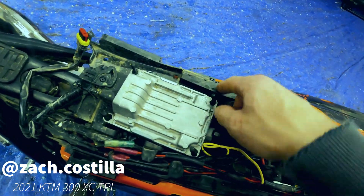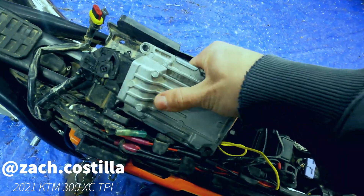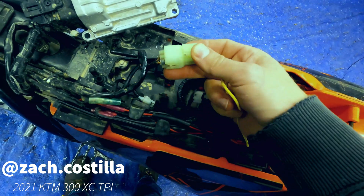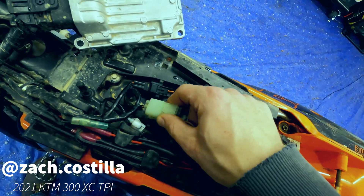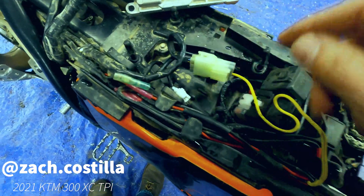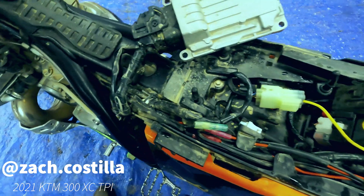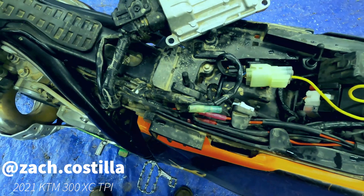And then under the ECU — there's this white plug right here. Where the yellow lead comes out, that's part of the kit. There's just this empty white plug down here on the XSC models. This wire comes out and goes into this wire harness here, and that's as far as the leads go. So you are going to have to be comfortable with crimping wires, and you're going to need a little bit of your own two-conductor wire — I used 16-two stranded.